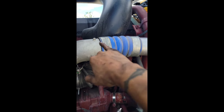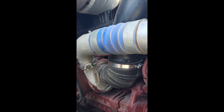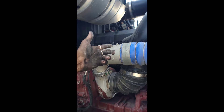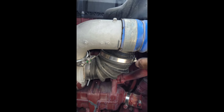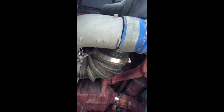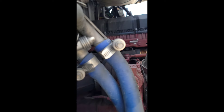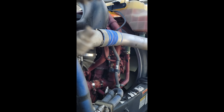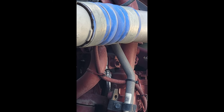I'm looking at the turbo hose and I'm seeing a clamp on the front, but there's no clamp here. What I like to do is look at the seal and then shake it for security. As you can see, if I shake it, it is not secure. Let me get a better view — let's look at the area where there may be issues.